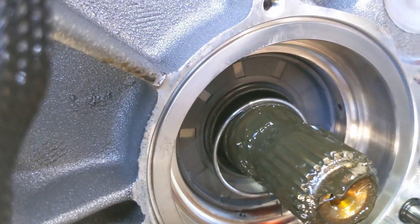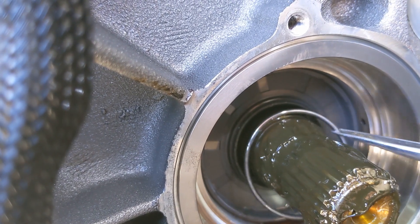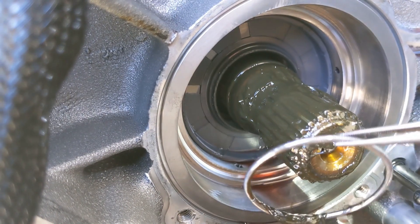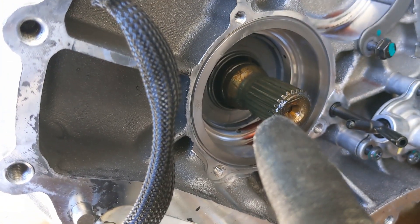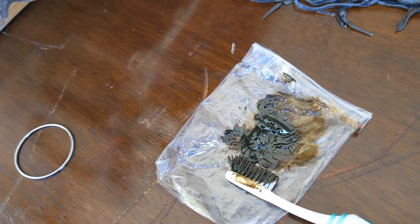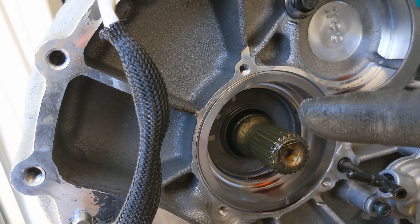This is the motor shaft. We can already see there's a seal over there and this is the spring that belongs to that seal. With a toothbrush I removed most of the grease from the spline of the rotor, put it in a ziplock bag going to turn it inside out and reuse it in the future, because I have no clue what kind of grease it is or where to buy it. I want to pull this rotor back in that direction, and there may be an aegis brush that I don't want to contaminate with this kind of grease.